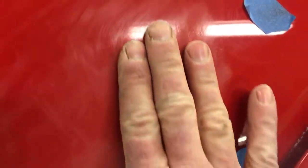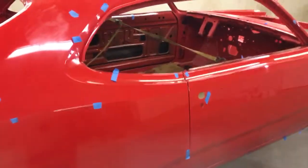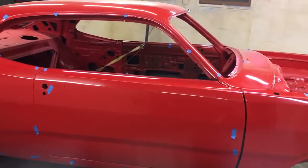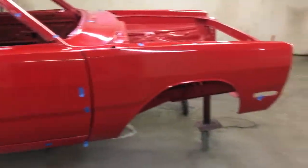And there's a lot of little things on here that I didn't like, and there's like some high spots that when you hit it with a block sander, it shows real bad. Stuff like that on the trunk. Some other low spots and high spots, and it just needs to be blocked out really good and resprayed. So we'll put some more color on it, a whole bunch more clear, and then you know, color sand it and buff it and all that good stuff. So I'll let you guys follow me along on this build right here. This is just kind of a shop update. Figured I'd show you.